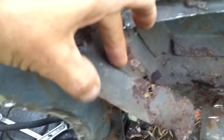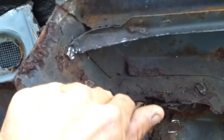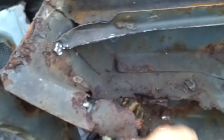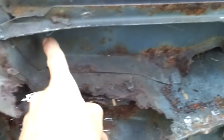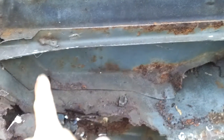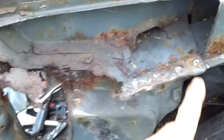Some of these curves — it curves down. It would be easier to make one curve out of one piece of sheet metal, do the next one, and then just weld the seam and grind it down. You can't weld it in there — you have to take it back out and do all the grinding. At least it's one solid piece. I'm probably going to end up cutting the cowl high so I can get as far in as I can and cut all the old stuff out and re-weld in the new stuff. Once you have the inside and the outside, then you can do the top of it and build it from there.